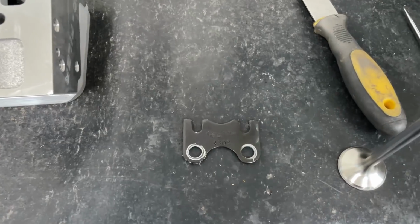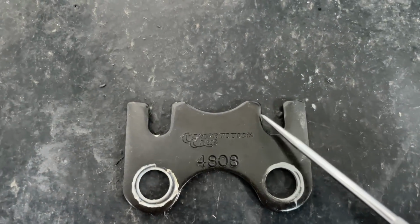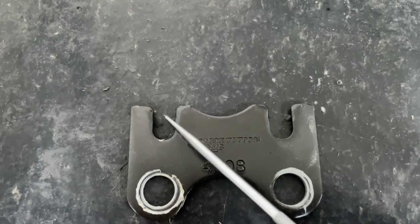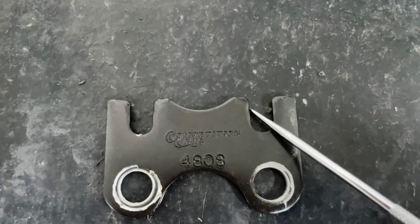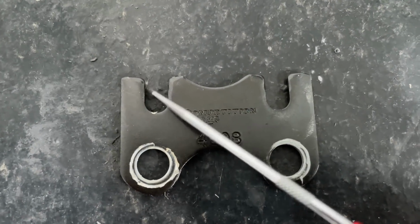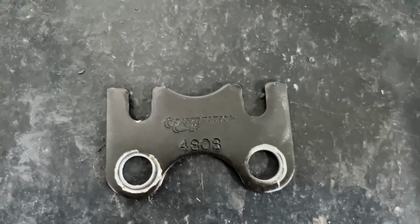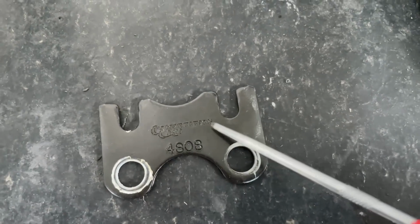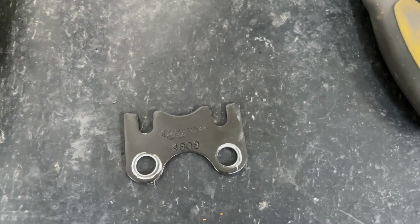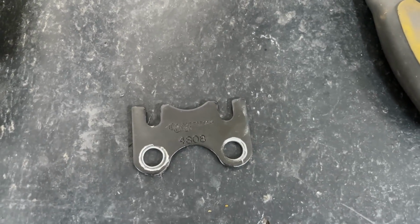And then I came to this guide plate. Do you see a problem? The push rod actually rests right here. Notice how it's got a notch there and there? What it did is it caused the push rod to move too much, so it couldn't be where it needed to be. So I had to replace, because one was that way, another $25 for a whole new set, just so I could put that engine together.